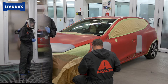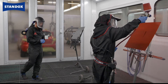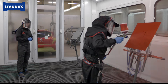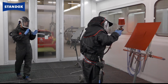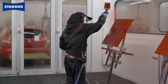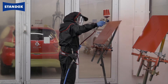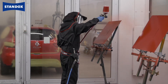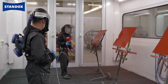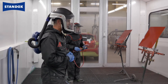Next time you see me I'll be in the spray booth and I will actually be producing the spray cards. It's important that as the painter I make the spray outs up front. So we have three panels here — we apply the base coat on all three panels for hiding, and we do this because we want to ensure that we have identical application later on, also on the car. You can also use an old car panel to do that.